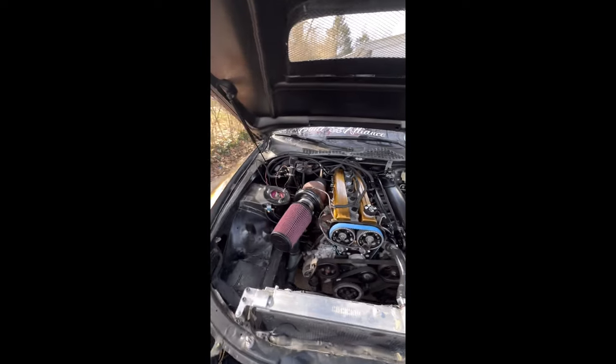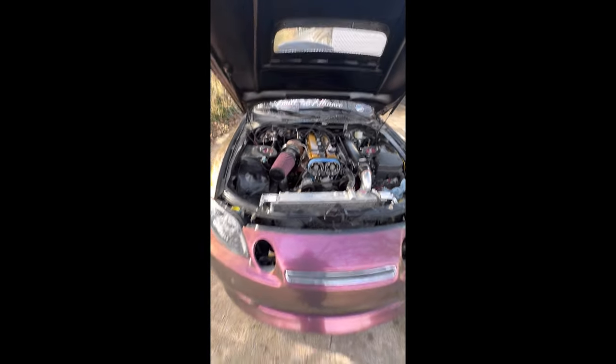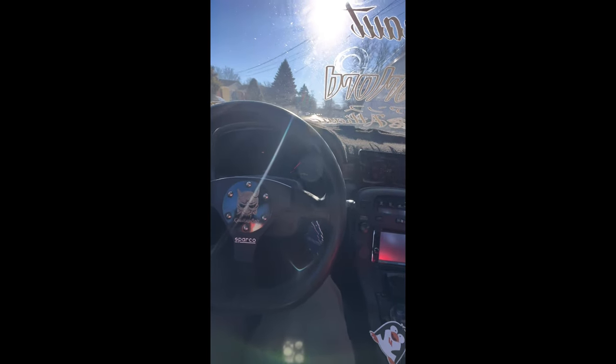I'm going to come back out here probably sometime tomorrow and drive it around the block a couple of times to make sure the wheels don't lock up before we try to tune on Sunday. But so far so good. Test driving and actually making sure the brakes work - they didn't lock up yet and they are actually stopping. I ordered those EBC performance pads because they recommended it and I can see why. With this ABS delete I do got to give it a little bit more foot power to stop, but it's not too bad. The tablet is reading perfect.